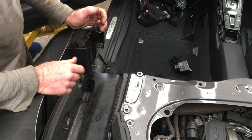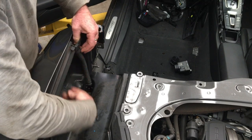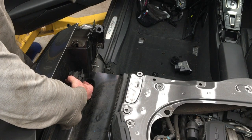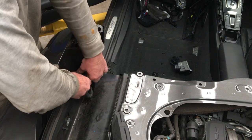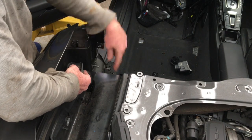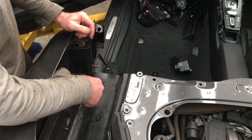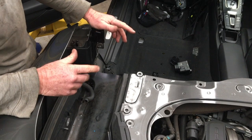To clear the drain hole itself - when the roof is all the way on the hose sits straight, but when you lower it the hose goes into a bend. If you have the roof lowered to about a foot to a foot and a half to go, this opens up quite nicely and you can see down in here. You'll need a torch because it's really dark. You can get a dowel or something and move things out of the way gently. If there's gunk down there, get a compressed air gun with a long flexible hose, shove it down in there, and blow all the gunk down and out through those one-way valves at the bottom.